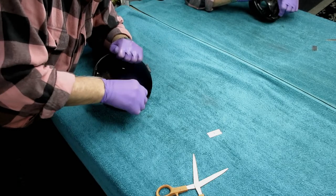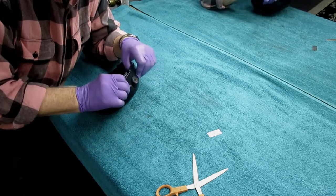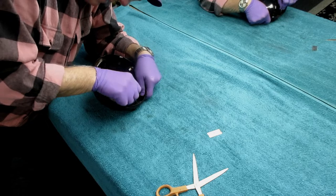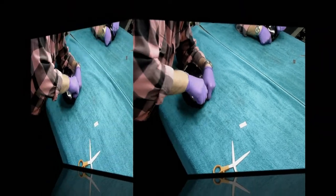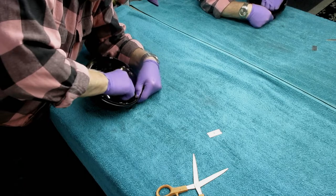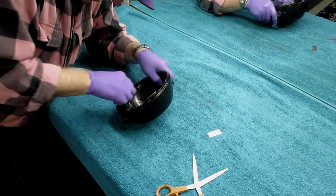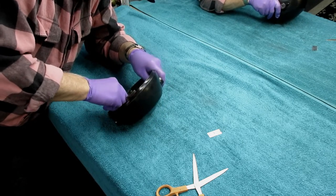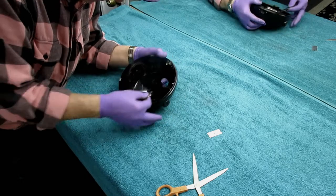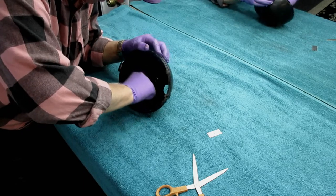It takes a little time, but we'll make sure we get plenty of paint down in there. This piece is a laminated piece with two rivets holding it on. Moisture gets down in there and when everything else is dried up, there's still moisture in there rotting the metal away. A lot of his bikes are in Motorcyclopedia, so I don't want someone to walk by and say 'what a shame you didn't restore that headlight up to spec.' We want it up to spec if we can get it. There's always a point I remember, even from modeling: you've got to do the prep. On a rainy day, who cares — we can't go riding. This is a part I know Dale will treasure, and getting it done right is really important.